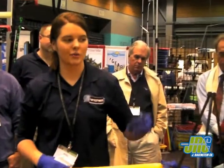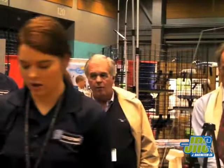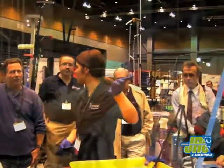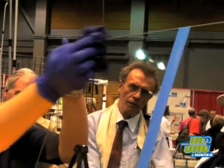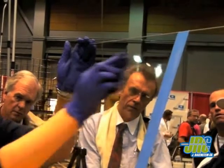Now that the glass is dry and we've verified it's completely polished with clean water, we spray the treatment fluid onto the applicator — not directly on the glass. Depending on the temperature outside, the fluid will dry very quickly on the glass, especially in direct sunlight, and then you're going to leave spotting. So you rub the glass like this, which pushes the treatment onto the glass surface, and then you level it out.